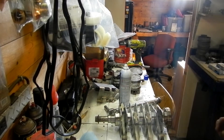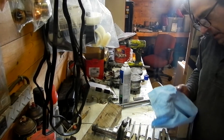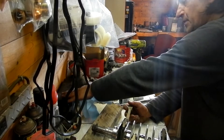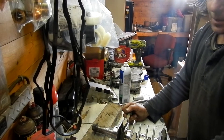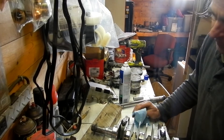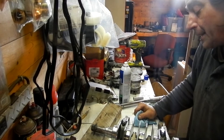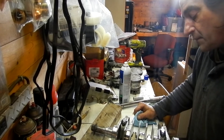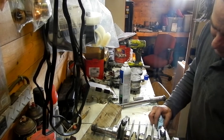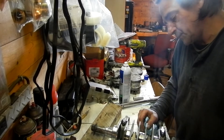Last one. Of course, when the phone rings or somebody comes while you're doing such a job — it did happen to me once that I forgot a bearing set on one rod. Just make sure, because you will feel the gap, the looseness. They're all tightened and that's finished. By the way, this engine is not old — it didn't need any machining to the crank. It was just full of a brown mix of oil and coolant to the point it had to be cleaned.